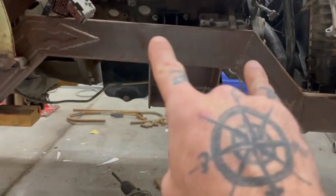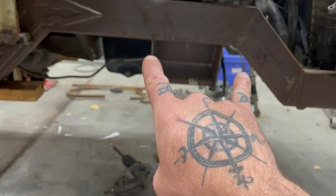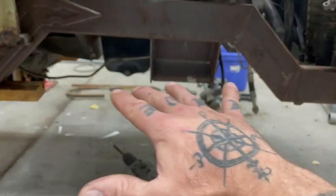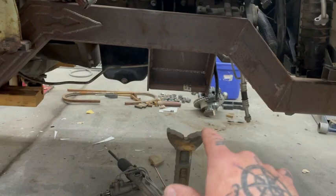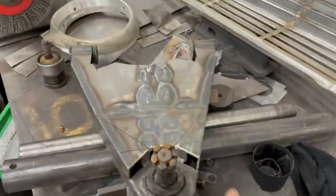Okay, you can see I just have my cross member in there. It's about the same width as a Heidts Mustang 2. I did it wider because I want to try and counteract some of that leverage without having to do weird kickers and all that other crap. There's a spacer in there I'll have to knock out.